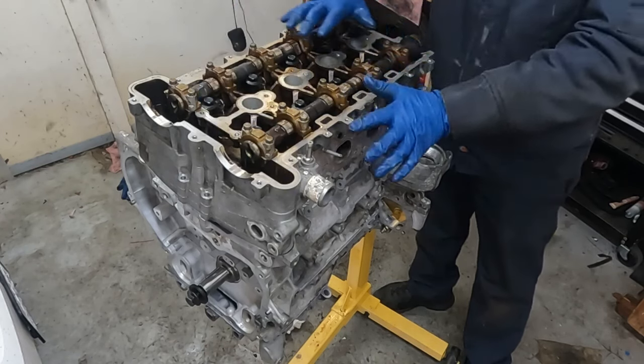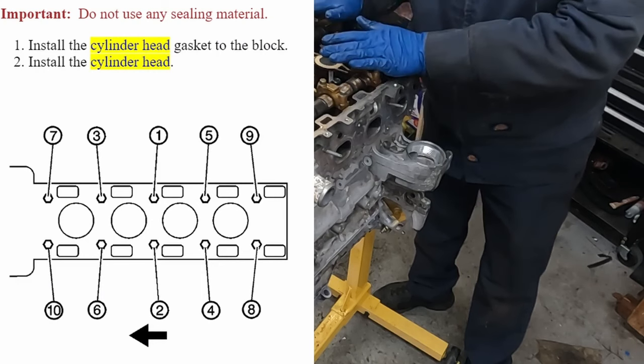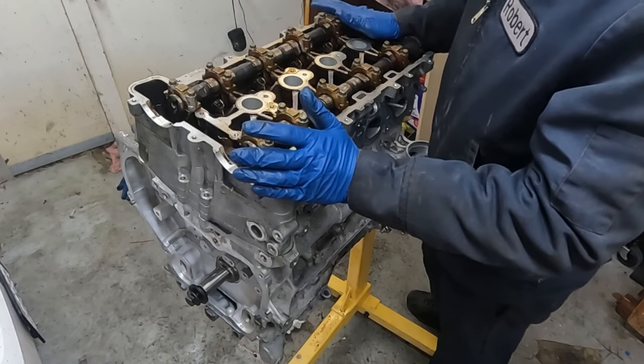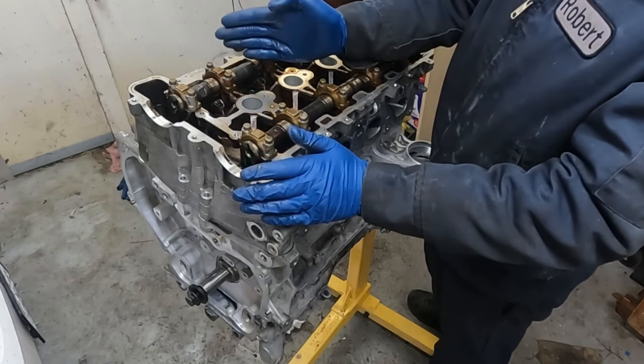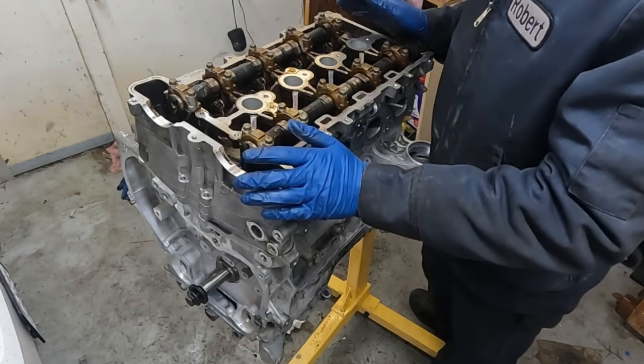So just that same pattern we've been using. I'll throw the pattern up on the screen so you can see it. 22 foot-pounds. All right, now getting 155 degrees is gonna be a little tricky. You either need a dial indicator to let you know how many degrees you went, or we could do our best guess with some math.